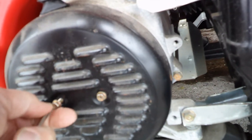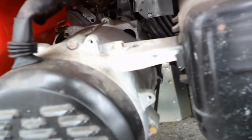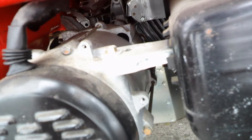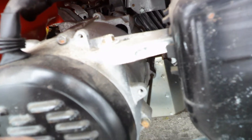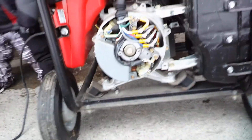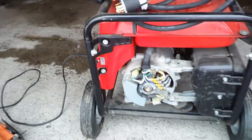I've seen on the internet other ways of people taking grinders and drills and just running them on the concrete, or rolling them just to get enough voltage, but I didn't have any luck with that. So I found a technical service bulletin from a marine place and they recommended this. I've seen other YouTube videos but they never told me how long to hold it on the battery — they said a couple seconds. This one actually takes the full 10 seconds. So underneath this cover you'll see these red and white wires. There's a positive and a negative in here.